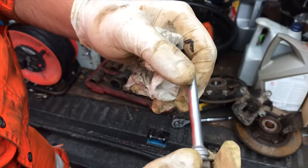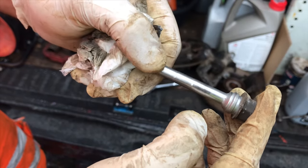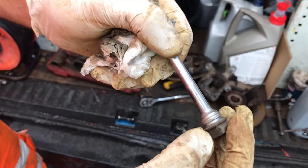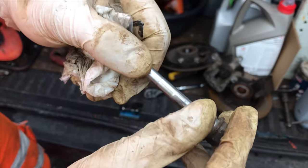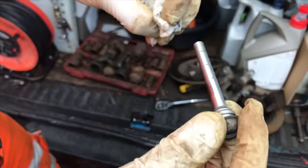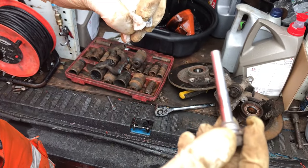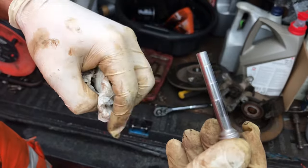Spotless as you can get it. And if it does have some mild scoring — like you can see this one here, there's like a slight shiny spot — that would be a little bit of wear. You could feel a little bit of metal-on-metal contact when we did the other side. It's where this wasn't greased enough before and now it's got a slight wear spot.